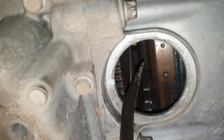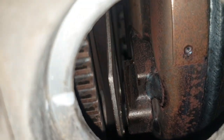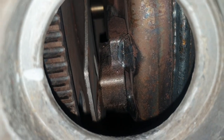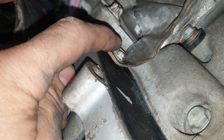When turning the engine over I'll just use a pry bar against the ring gear teeth with small movements. With all those bolts removed you should be able to push the torque converter back — it'll slip back. Just take reference of the gap you've got; the torque converter should spin around freely. While you're in the area, there are two plastic covers — one on the left and one on the right-hand side — just needing two 10mm bolts to undo and pull them out.